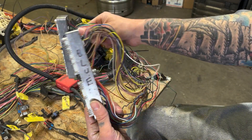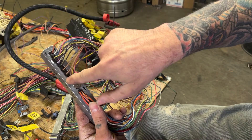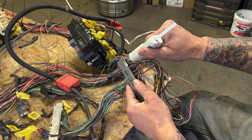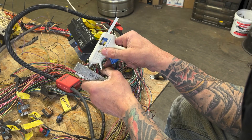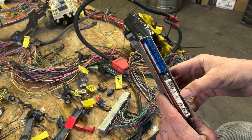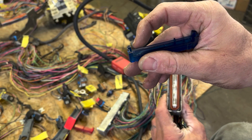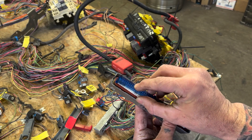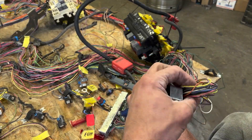Now that I'm sure the connectors are all done — all the ones that need to be removed are removed and we added pin 42 — we need to make sure these are watertight again. I'm going to fill any empty holes with hot glue. When reinstalling the color caps, make sure the pins are straight and go where they're supposed to in the cap, and that the slot at the end lines up with the tab on the connector. Then replace the gray cap on the back and do the same for the red connector.